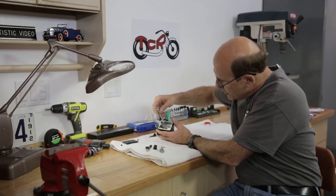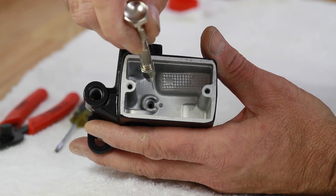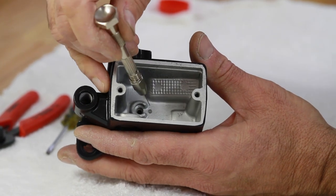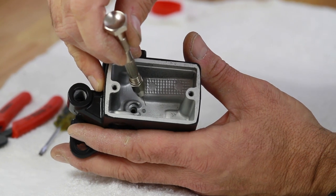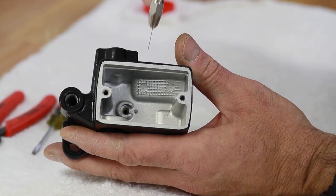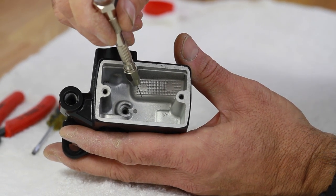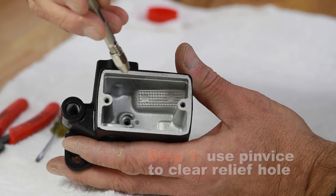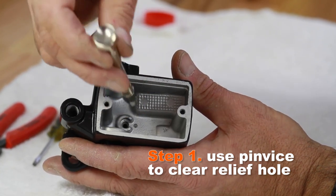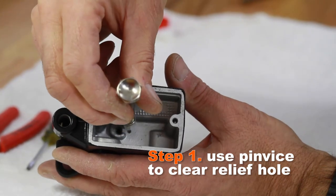Inside the reservoir, you're going to see two holes. The large one is what allows brake fluid to go from the reservoir down into the bore and get pushed out through the lines. There's also this other very, very tiny hole — some people call it a return hole, some people call it a relief hole. It's very critical that that's kept clear. What happens over time is brake fluid will gunk up that hole and block it, and the end result is it doesn't allow fluid relief when you let go of the lever, and your brakes will actually drag. So before you rebuild, you want to take the pin vise with a number 80 drill bit, go into the hole, rotate it, and basically ream it. If you don't have one of these, you can do it with a fine steel guitar string and a pair of needle nose pliers, but this is definitely very handy and inexpensive.